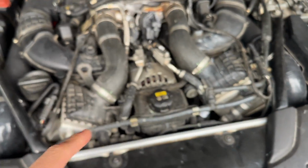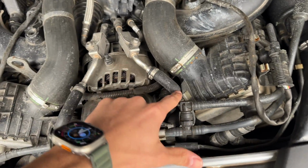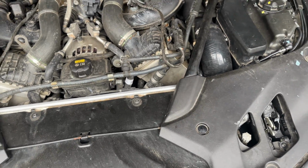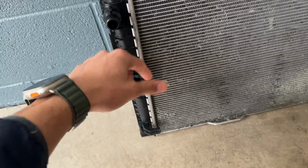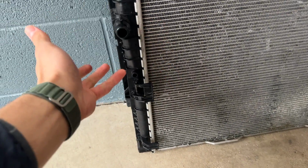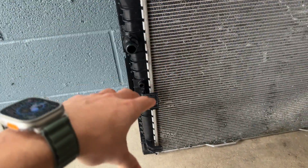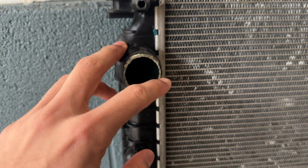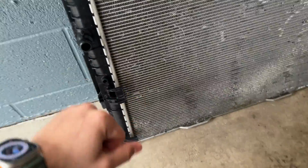Coming back over here real quick, you see these turbo coolant lines right here going up. The one on this side, the pump that is sitting down here, it actually sits on the side of the radiator. It is actually clipped onto the radiator as a strap. Obviously took it off this to put on a new one. There was a strap that held on the radiator, or the auxiliary water pump, and when I was at the shop, he did the pressure test. It was leaking. Obviously, you see the seal is very worn here. It was leaking out of this, and that pump failed completely.